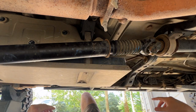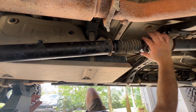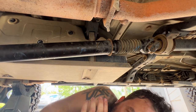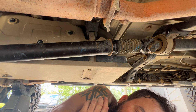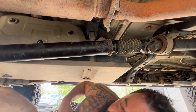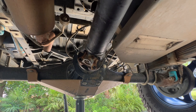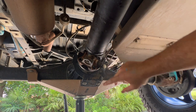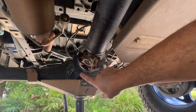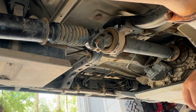So to deal with these clamps right here, you've got several different options — good old hose clamps will work. I might have something left over from when I did the axle that'll fit, but I feel like the ones I have are either too small or too big. Also — if your alignment lines don't line up, go ahead and remove your emergency brake, chalk your front wheels, lift this up, and just rotate the axle so that your lines line up — the u-joint to the axle flange.